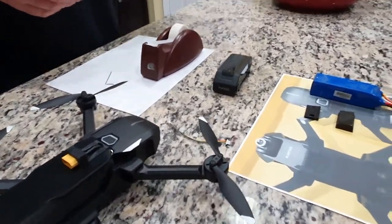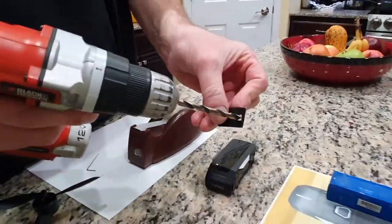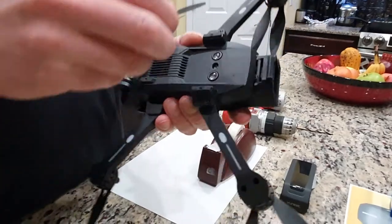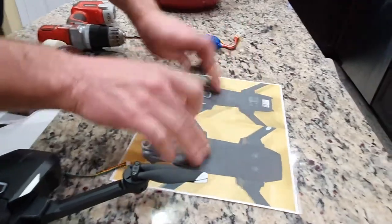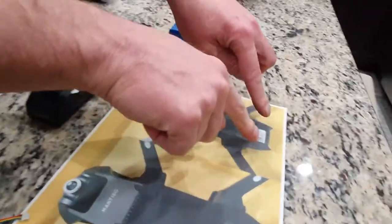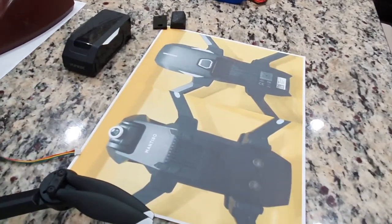The tools you're going to need: a drill bit — get one that's going to fit the size of that square right there, pretty close to the size of that square. One small Allen tool that's going to fit these little Allen screws, and some tape. Included with this kit is a picture. Because there's so many small screws, we're going to tape the screws as we remove them to this picture in their location, because there are so many different sizes and we want to make sure we get them back in the same location.